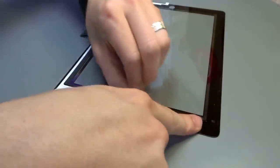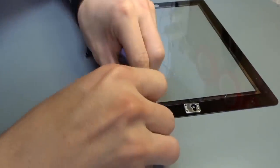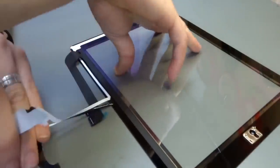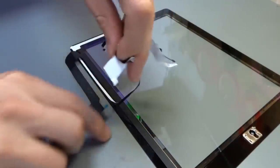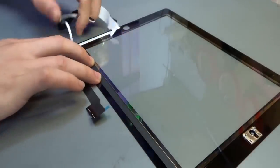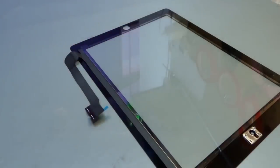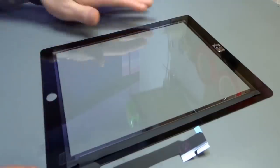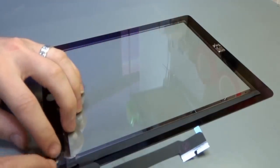There's a plastic layer protecting the inside — there are actually two layers: the outer glass and the inner glass where all the circuitry is, sandwiched together with a clear plastic layer on the inside. That's why he's putting his hands all over it, knowing the layer is protecting it. Once you peel that layer off, you obviously wouldn't want fingerprints all over it. So, peeling the adhesive off, we make sure it's clean enough to put our adhesive on. There's a clear plastic tab for the adhesive layer — we move it and bend it at 90 degrees so it sticks up instead of sticking flat, making life easier when laying the new tape down.